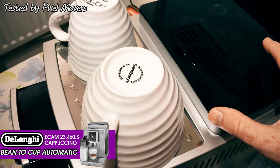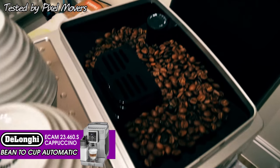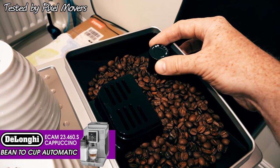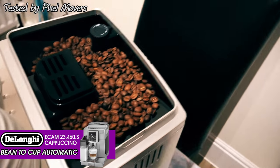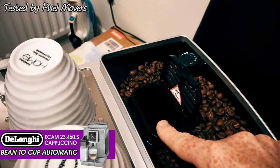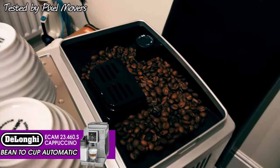On the top there we've got the cup warmers and the bean hopper. You put your beans in there, and there's a little dial which you can change the coarseness of the grind. For example, if you had a cafe crema you can do a finer coarse grind and that will give you more of a creamier cafe crema. There's also a port for just one spoonful of pre-ground coffee, so you can use pre-ground coffee in this as well, but just one spoon at a time for one cup.